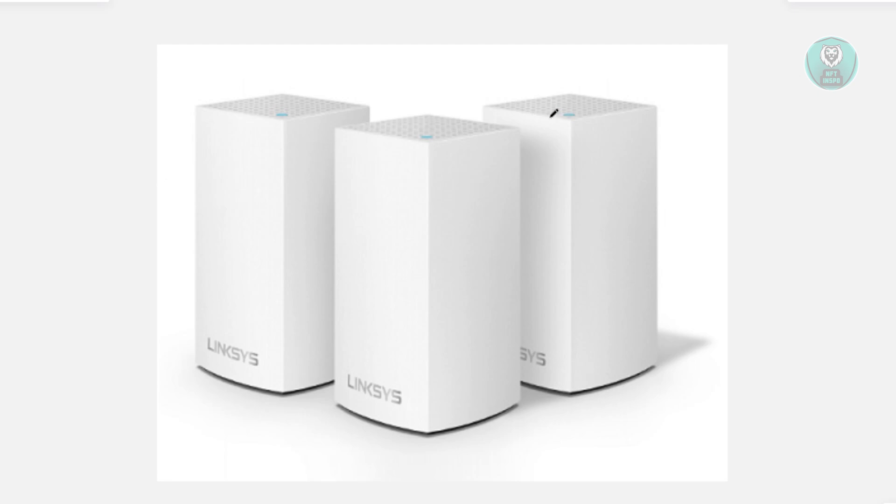From then on, connect your mobile to the Linksys mesh Wi-Fi network. Open the Linksys app and tap the menu icon at the top left corner, then tap on Setup New Product. Select Add Another Node to your Wi-Fi name and choose Extend Wi-Fi with a New Child Node. Complete the setup by turning on Bluetooth when prompted, tap Next when asked to plug in the node near the router, then tap Node Light is Solid on the next screen and wait for it to connect.